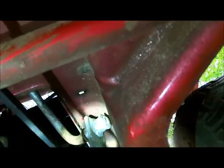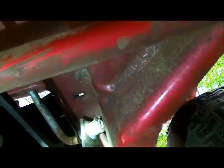That's what it's called. Now, see this thing right here? That's your gear shift. That's what changes the gears. This is the gearbox. So when you say that the gearbox is bad, no. The gearbox would be bad if I couldn't shift it at all, whether the engine's on or off. I can shift this perfectly with the engine off. I can put it in fifth gear and start the engine. She'll just go like a bat out of hell. I can put it in first gear. She'll go right along, like you saw in the beginning of this video. As long as I start it in gear, it should be fine.